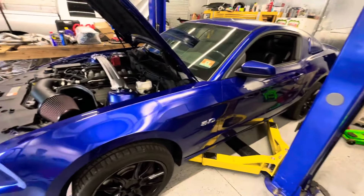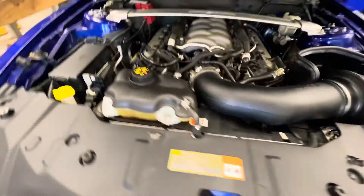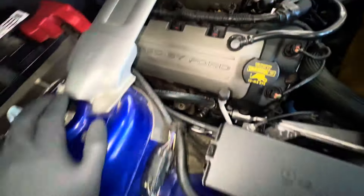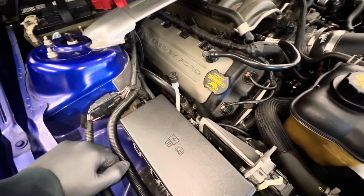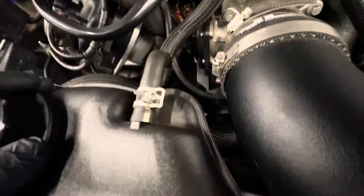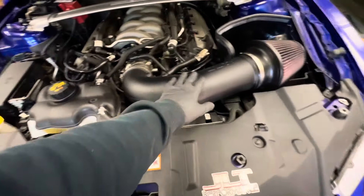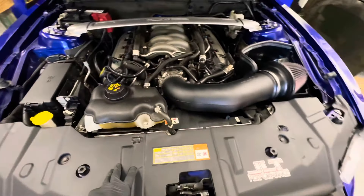She's down. First we're gonna be removing that bolt right there and the nut on both sides of the engine so that we can remove the motor mounts off the engine to access some of the bolts on the manifold. To access a couple of the bolts we also have to access the AC compressor and move it out of the way, so we're gonna start by removing the intake and this reservoir here.